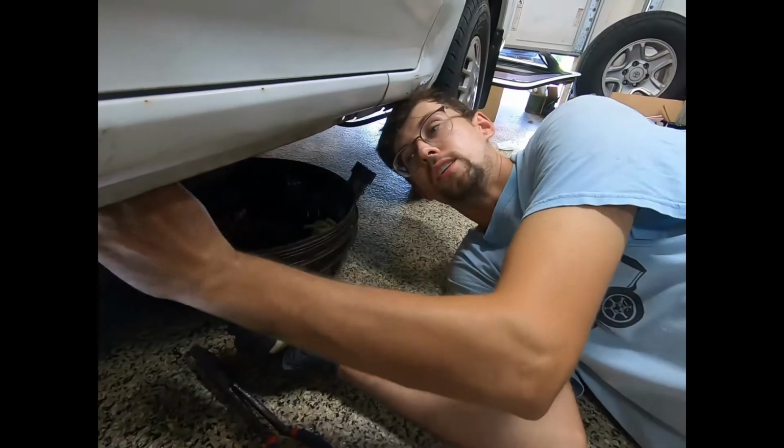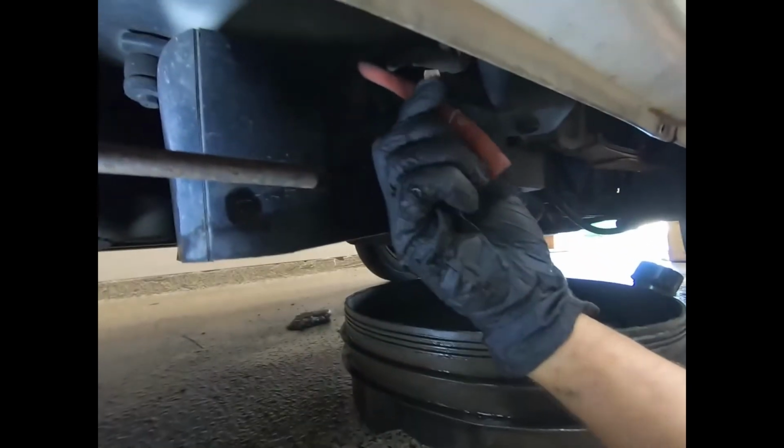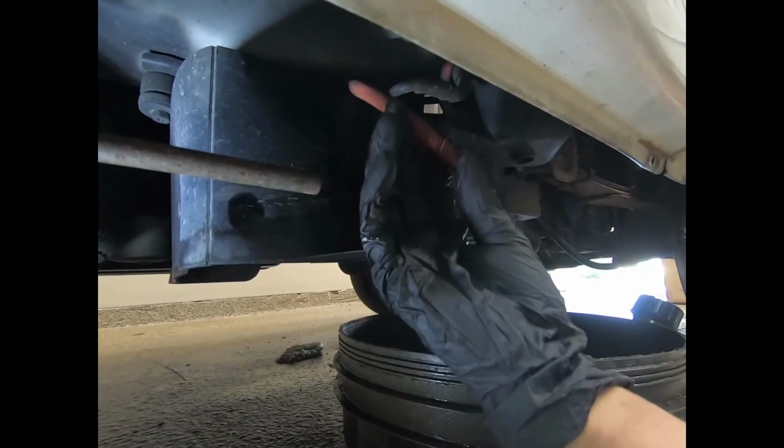So one thing I realized on how to stop the gas from flowing is this is the fuel line that goes to the tank. It's going to be spewing out gas. So what you do is you raise it above the highest point on the gas tank, let all the gas run to the gas tank. So you just have air in the line and then pull it back. And then there won't be any more gas coming. So that'll stop all the gas from flowing out.